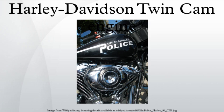Development of the twin-cam started in the early 1990s, as Harley sought to address issues affecting the previous Evolution engine, particularly structural weaknesses within the crankcase, oil circulation, and leakages. While aftermarket firms such as S&S Cycle previously responded with stronger crankcase components for high-performance evolutions, Harley went for a significant redesign, keeping the engine fundamentally and aesthetically similar to the 45-degree air-cooled overhead valve concept Harley has used since it introduced the V-Twin to its lineup. The twin-cam only shared 18 parts with its predecessor, as almost all components were unique to the engine. As the name implies, the engine uses two chain-driven cams to comply with EPA noise regulations. The drivetrain was reinforced through a mounting scheme called the Revised Rear Interface, allowing the transmission case to be mounted directly to the rear of the engine, with the primary drive and clutch covers playing less of a structural role.